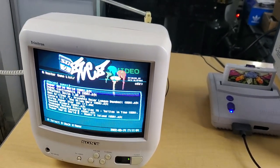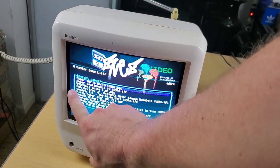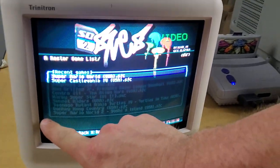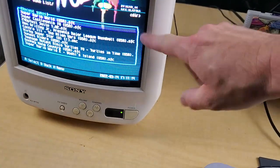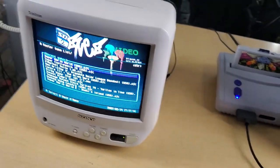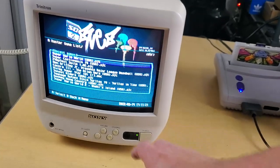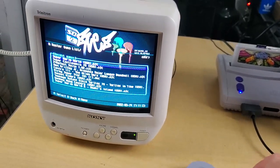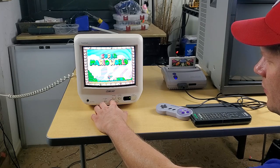Wow, and that is just composite. You can see there are some squiggly lines here along both sides. It's undoubtedly time for a yoke adjustment and new capacitors in this thing. Let's go ahead and pull up a game real quick. The volume works.